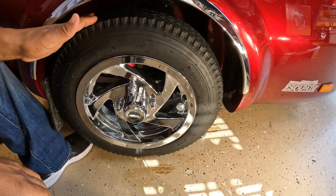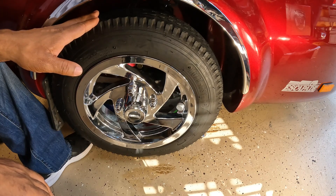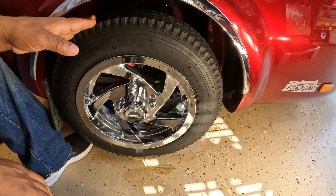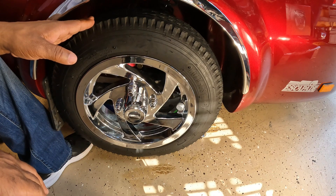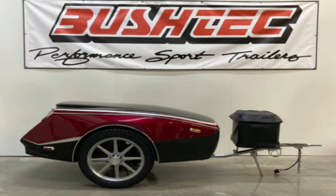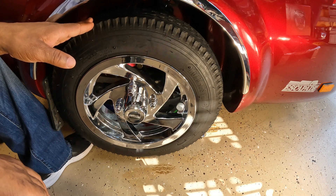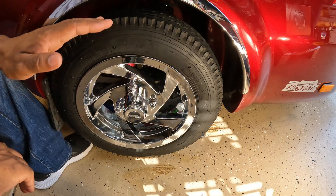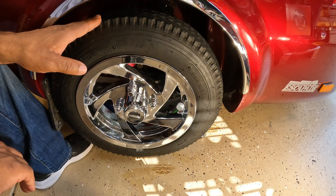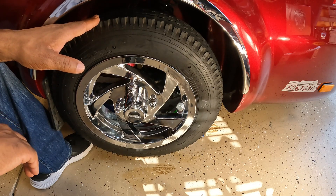This concludes the video of me inspecting and repacking the bearings on my 2021 Escapade trailer. Just keep in mind that if you pull a trailer with your motorcycle, you must repack your bearings. Most trailers out on the road have greasable bearings and you must repack them with grease. Some trailers have sealed bearings - in those cases you do not have to fill them with grease, but when those bearings go out you're going to have to replace them altogether. If you guys have any questions or comments, feel free to put them in the comment section below. If you like this video, be sure to click the like button, and if you haven't already, subscribe to the YouTube channel. This is your boy Chris, showing you how to maintain your trailer regardless of the brand - talk to you guys later!